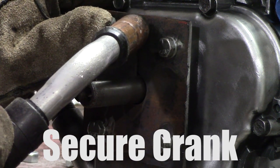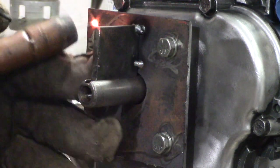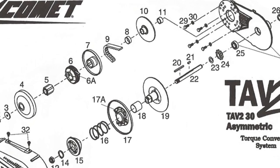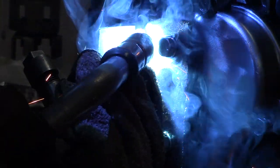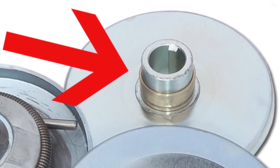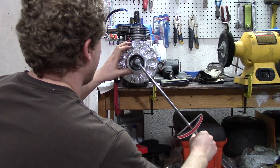The next step is to secure the crank to prevent it from rotating when you torque down the flywheel nut. For those with a welder: get some steel plate, cut a hole in it — this is 3/16-inch plate — and secure it to the side cover to keep your crank from rotating. For those without a welder, all you need is a drill and four holes in the back plate of a 30-series torque converter. It has the same bore diameter and a key in it already, so that'll really secure it. The link is in the description. Don't use locking pliers — they will fail every time.